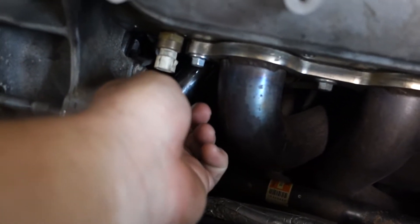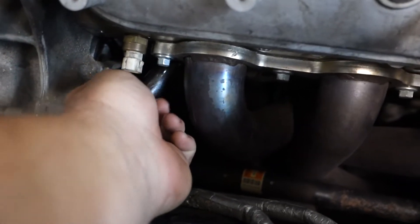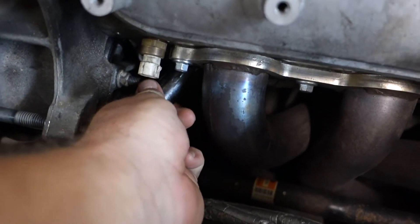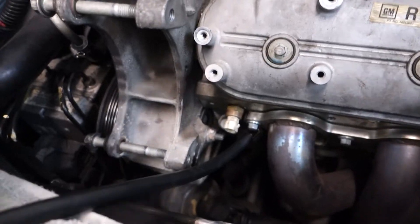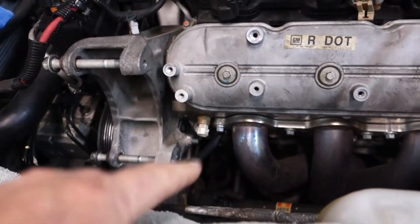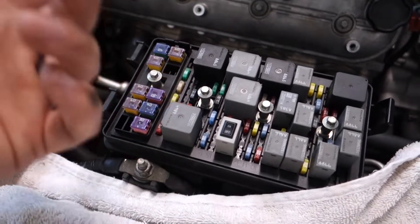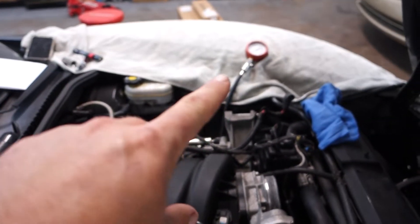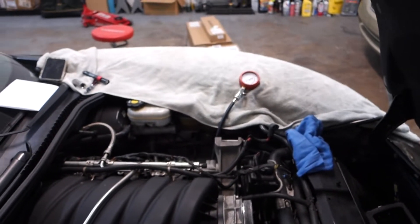To get that little adapter into the cylinder head, I'm using an 11/16 socket. You definitely don't want to put a wrench on this — just make it hand tight — because you have the little O-rings on there that seal it into the spark plug well. So we have the adapter, the hose, and the gauge all hooked up and threaded into the hole of cylinder one. Now you're just going to flip the switch, let the starter turn over six or seven times, at least until that gauge stops moving up, and then that will be your compression number.